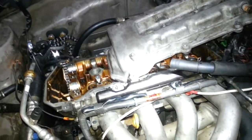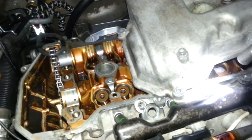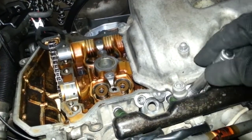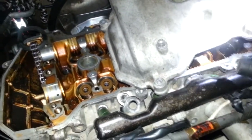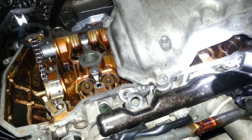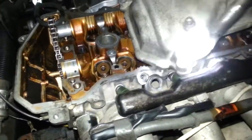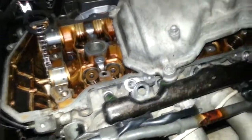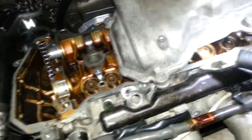I didn't film it so no one else saw this. But every time I've done a fuel injector and it's leaked, it's run crazy amounts of fuel through here. These leak - if this area right here pools up, it goes straight into the engine. I've about destroyed my engine just from fuel injectors over the years where I've had to do reseal jobs after replacement over and over again, until I got a little better at it. The water pooled here - that's how it sucked into the engine. That's how this engine got destroyed. My pod filter was completely dry, it's not what destroyed it. Water coming through here is what finished it off.